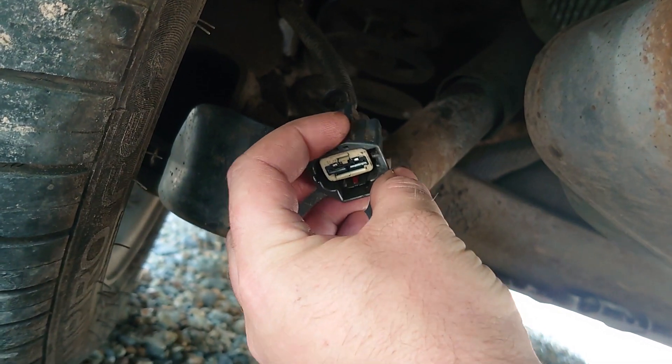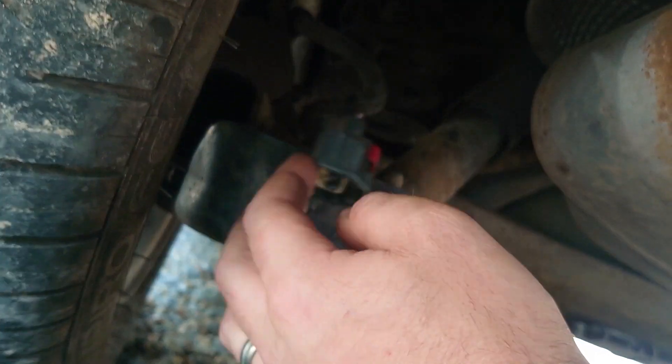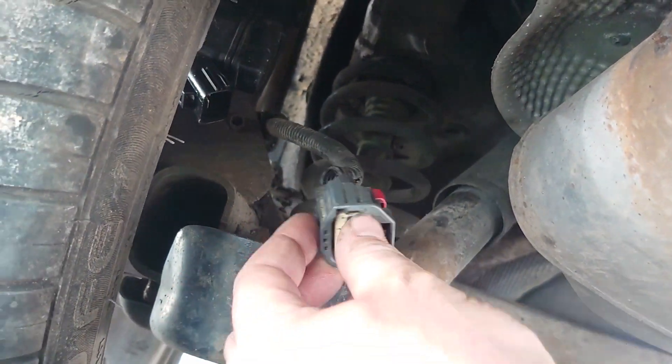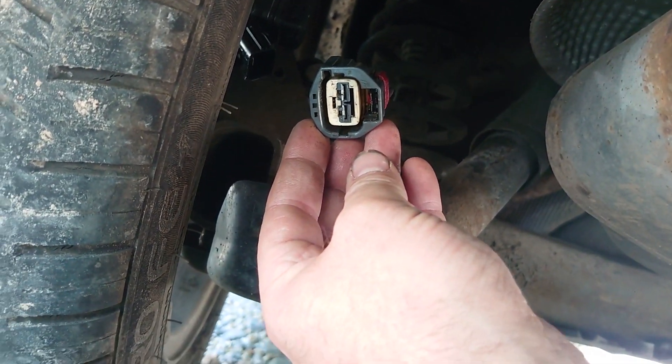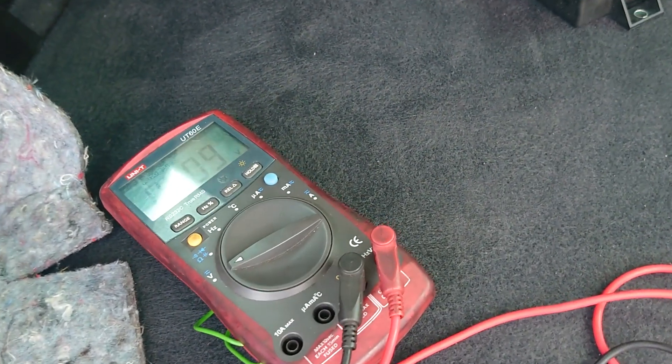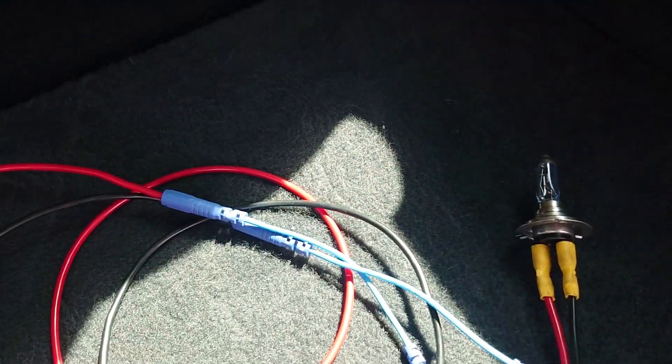The client confirmed he'd tested the wiring and it was intact, so we want to load test it. It's a big motor on the back of the caliper — nice shiny new one on it. I used the jump pack, cut the wires, jumped it up on those wires and put it through onto a test bulb. Lit up lovely — the wiring's good.